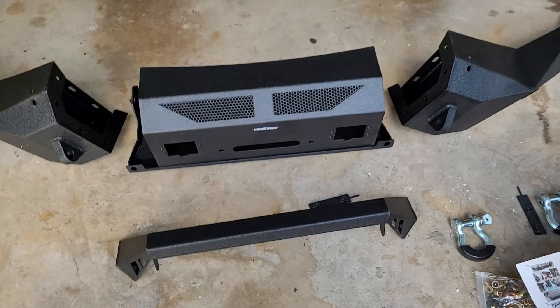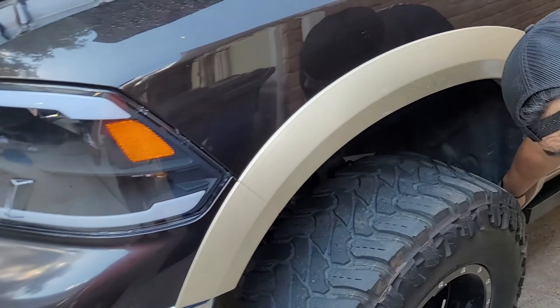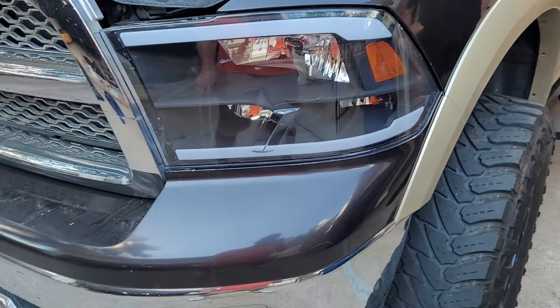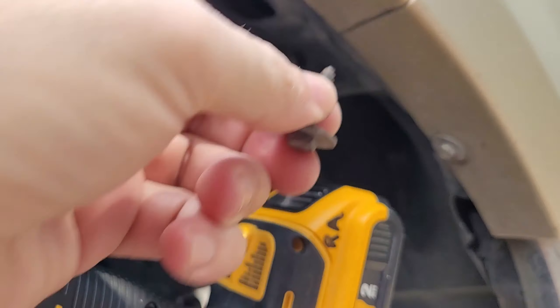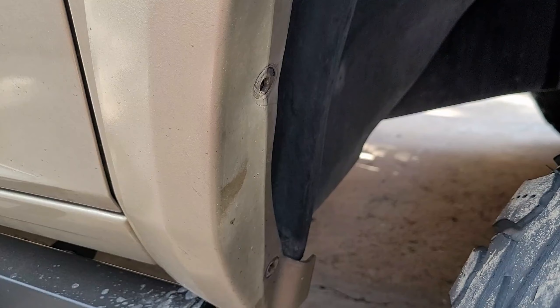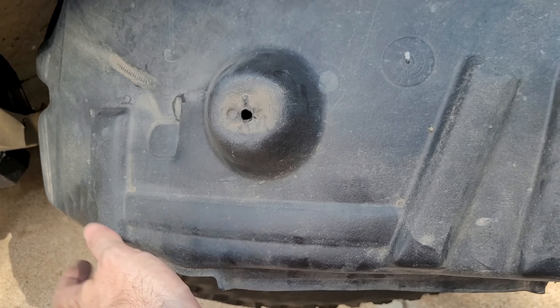First we got to take that off. To make things easier we're going to take the fender off because there are a couple bolts holding this section up here, so we're removing the whole thing — not just the chrome and lighting but also this little top lip cover. It's a two-piece. We're taking each one of these out, eight millimeters all the way around. We've got one, two, three, four, five, six, seven, eight all the way around, and two here in the middle, one here, one here. There's one clip also that just pops right out — that's on the inside.